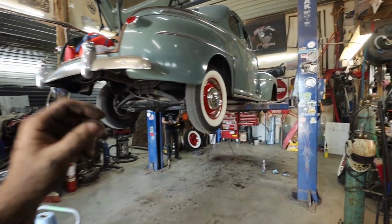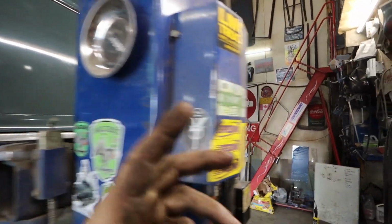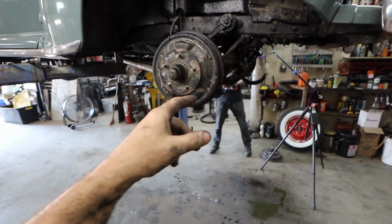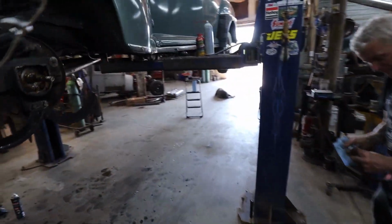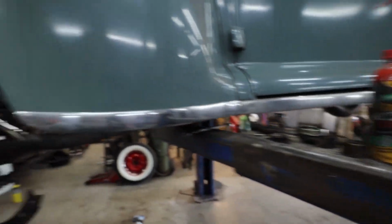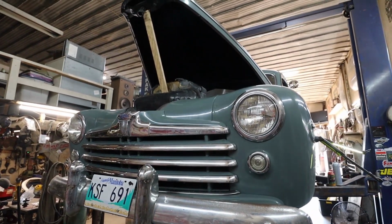And on his way here, while we had to pick him up, he overheated, so I noticed the thing doesn't have a pressure cap, so I'm gonna hunt around the yard. I'll find something with a pressure cap and we'll stick that on. He was saying he thinks his rad is leaking, so we'll just stick some Bar's Leaks in there and see if that works. We'll at least see if that'll get him by for now. Maybe the big picture, we'll just get an aluminum rad and stick it in and make everything better.